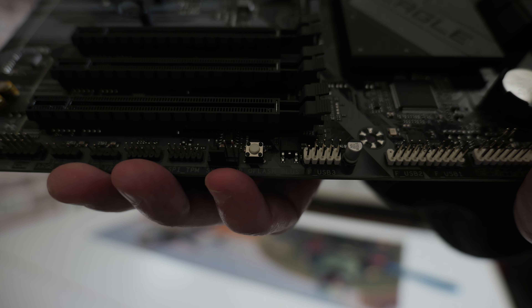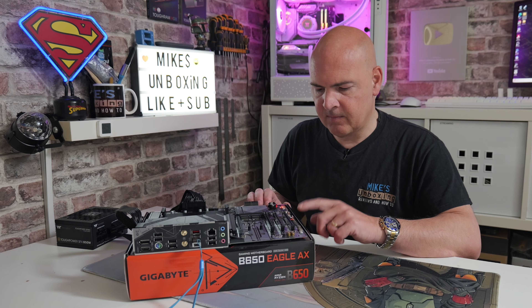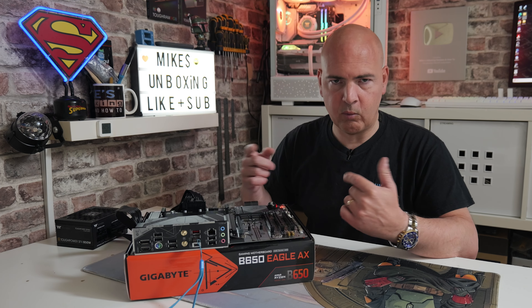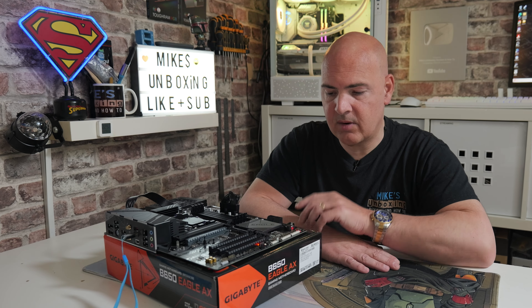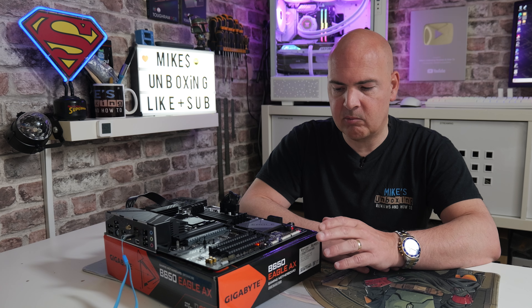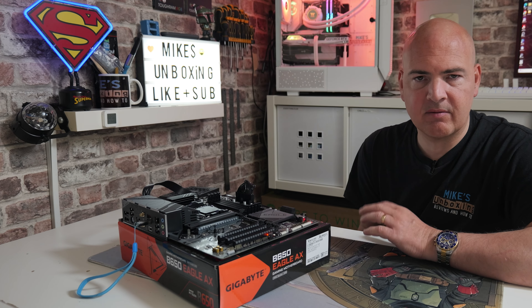You should see the BIOS flashback LED start flashing. You'll also notice that the diagnostic D-LEDs in the bottom corner will be illuminated on the CPU light — that is completely normal. The LED will flash quite quickly at first, then it should change speed at some point. When the speed changes to a slower flash, that means it has finished the first process — normally initialising the BIOS flashback routine — and is now probably reading the USB drive and getting ready to transfer the data into the BIOS flash ROM. The LED may change speed again as the process continues.